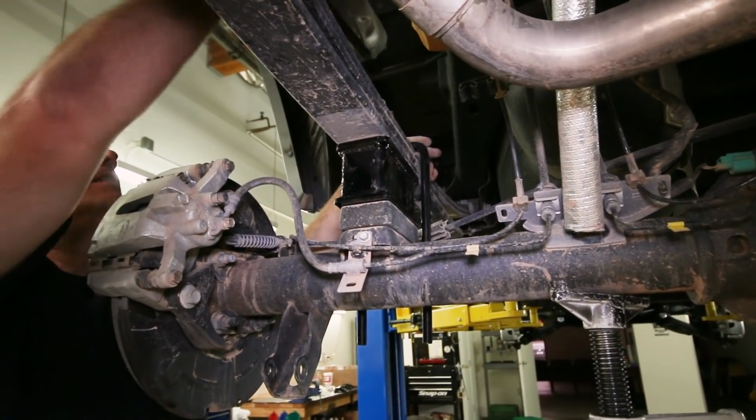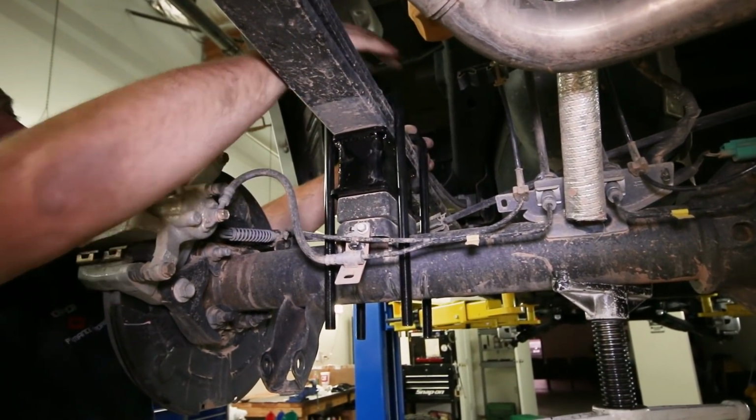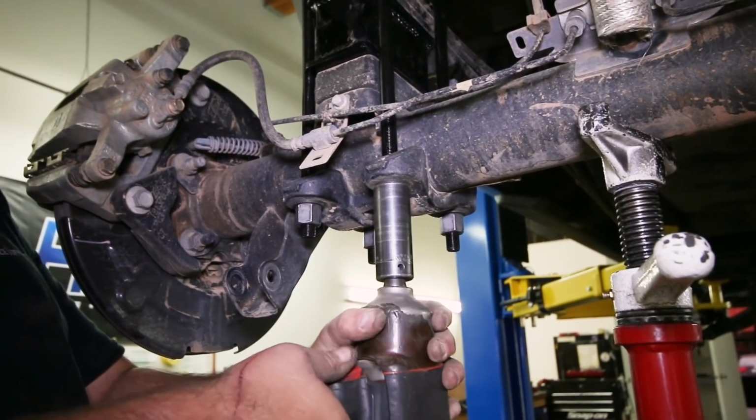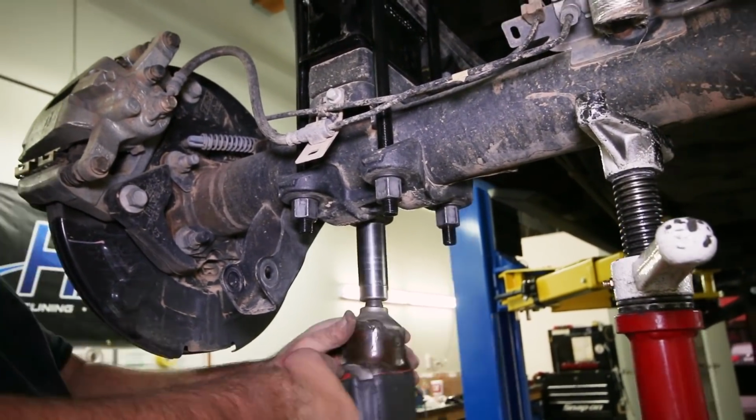Once you raise the axle back up, add the new longer U-bolts over the axle and slide the lower plate back on so that you can tighten the U-bolts with the new hardware. Be sure to tighten the 4 nuts evenly.